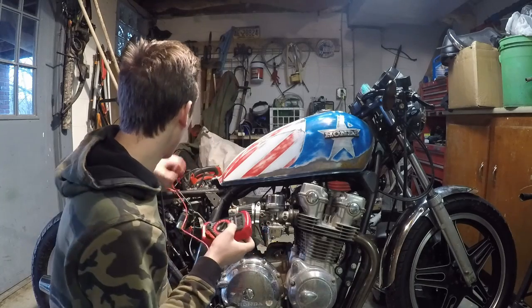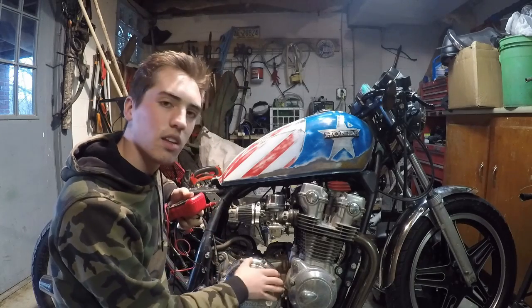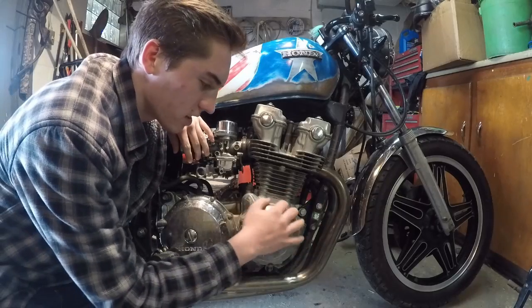As you can see, the number did not go up, so my battery is not charging — something's obviously wrong with the system. I'm having the opposite problem from the over-voltage issue. So the next thing to do is diagnose and look at the individual components of the charging system.